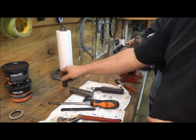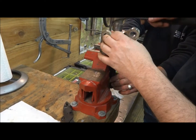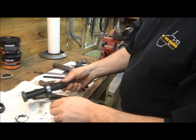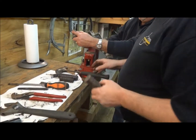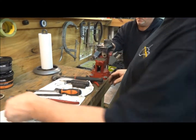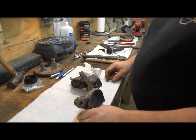So then the vise, I use a socket. It's made for a slide hammer and you pull it out, but if you use something and drive it out, it actually works a little bit better. There's the bearing in the center. Then I use this piece, it's a homemade, just been milled, so it's for the center of the bearing. And it goes in, it'll drive the bearing out. Then you want to clean up all this and go back with your new bearings.